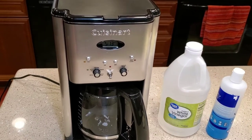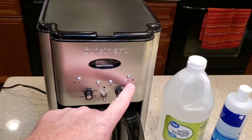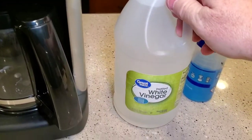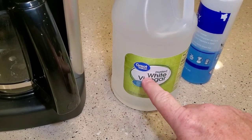We're going to use vinegar to clean the heating element — it's a descaling operation. It's got this self-clean button and I'm going to show you how to use that. First, you've got to make sure you've got some white vinegar — 64 fluid ounces. We're going to use a little bit more than half.